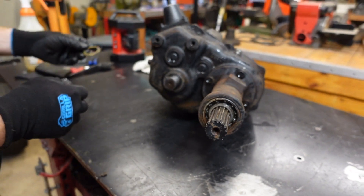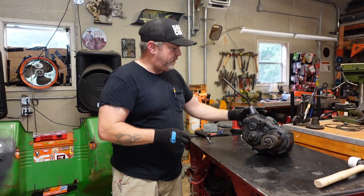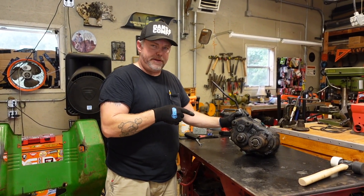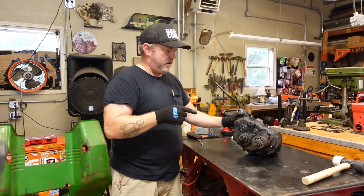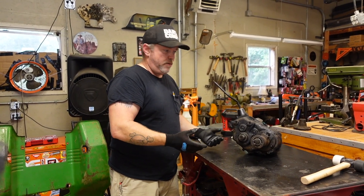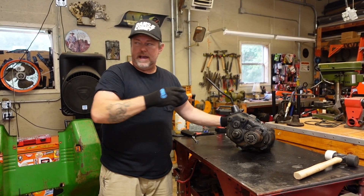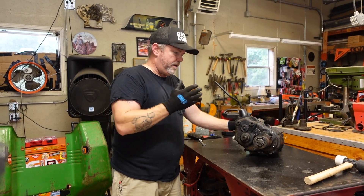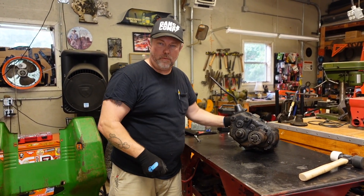The next thing we're going to do is remove the axle tubes. One more point of interest — this is a Peerless 2333, and these came in John Deeres. We're going to get the axle tubes off, get the case split in half, and pull off the upper case half as we saw on Red ZZ02's video. Then we're going to see what kind of differential we have.